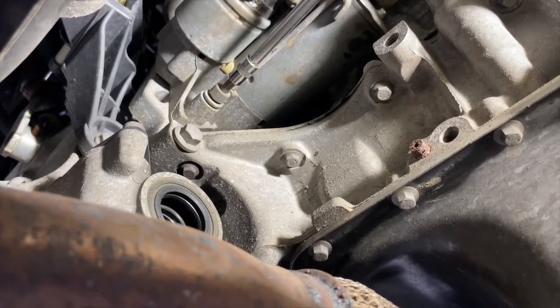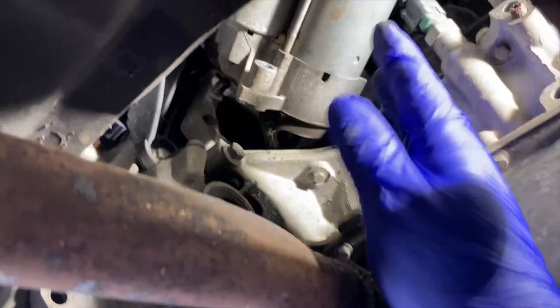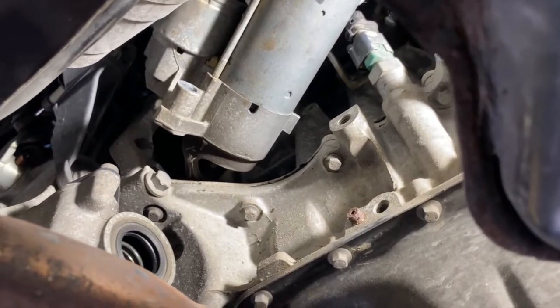So there are two bolts from this side, one around the top of the starter motor from this side, and then that one that comes in from the other side over the top - that's a real good tip because you'll be struggling with that. So I'll carry on and slide the starter motor back out of the way. I've just pulled him out and I'm going to leave him hanging off the cables. I've not done this job before on this car so I don't know if that's the correct thing to do, I'll just push it out the way.